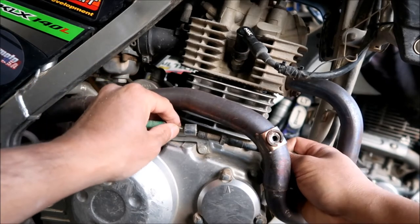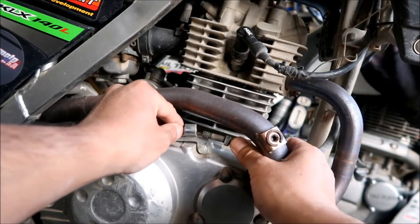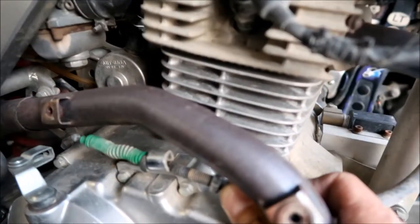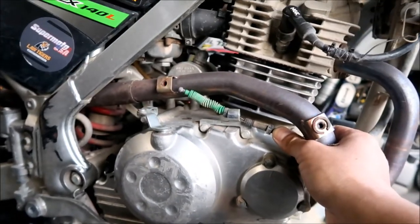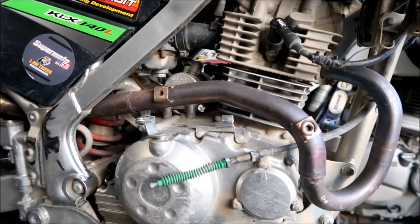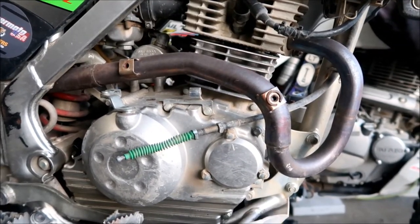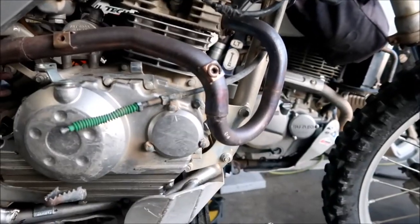When the cable is exposed you can just move it through the little slit in the back - it's kind of open, like a C-shape. Just take it out of the slot right there and it comes right out. Now the next thing is to just take the clutch cable out. Look at how much space there is to work on this bike - it's amazing, super simple. That's what I love about this bike.